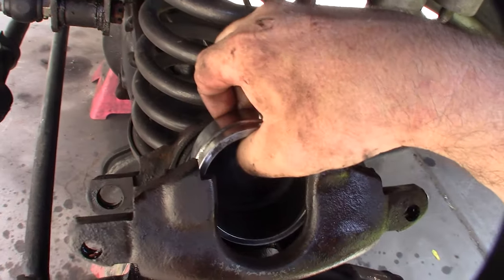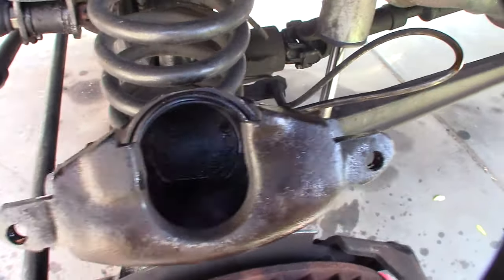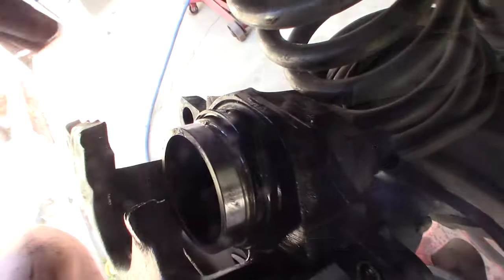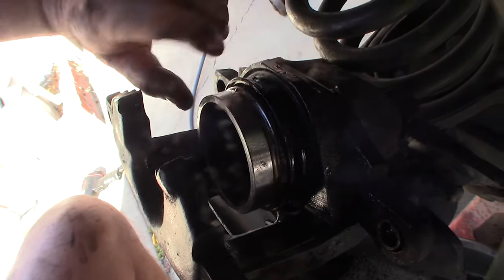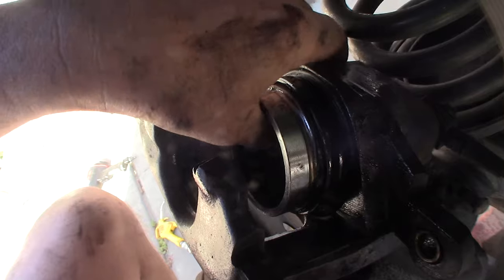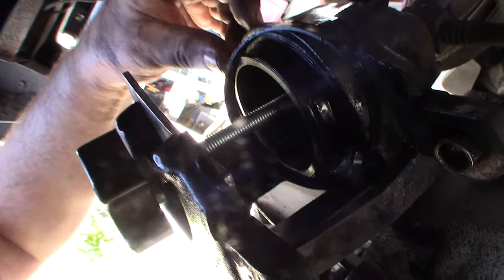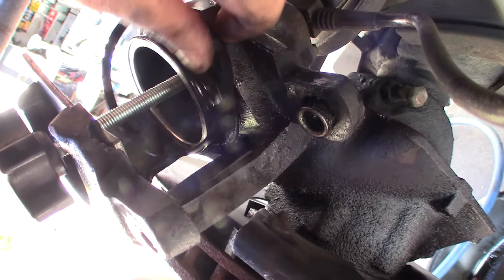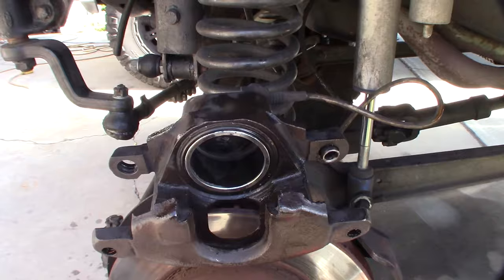I can slide it through the ring and get it inside. I need to lube it up a bit more. The seal is being held open so I can push the piston back in without too much binding. Once the piston is back in, I take off the little adapter piece — there's a little ridge in there that I need to make sure I seat correctly before the piston goes too far back.